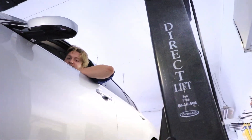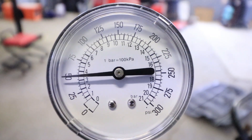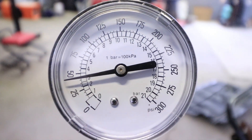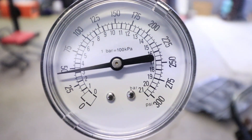Let me hold it at like 2,000 RPM. At 2k RPM we're reading 45 PSI. So after today's research we know two things: we are close to having issues with the valley gasket, and my old gauge doesn't work so we're throwing that out. You're gonna see some future videos — we're definitely doing all that work to seal it up, because he wants to break records and we can't do that on a questionable engine.